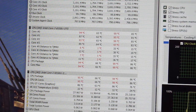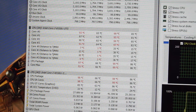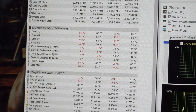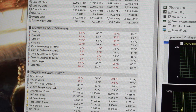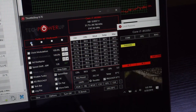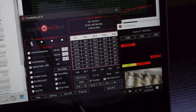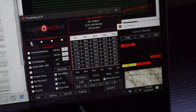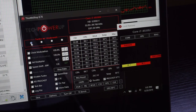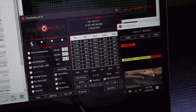It approaches 90°C and even hits 100°C at times. I strongly suggest repasting if you plan on gaming on this unit, especially if you plan on doing combined loads. I experienced downclocking to 800MHz on all four cores during gaming in some sessions. The i5 model might fare a bit better, but probably won't — it's pretty much the same as the i7 except clocked down, and at full load on the i7 it runs basically at i5 speeds.